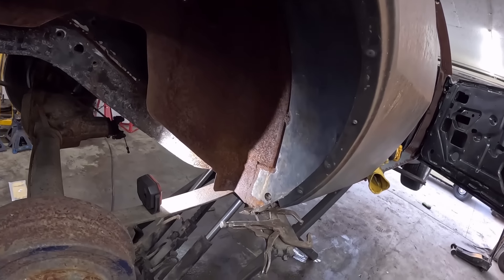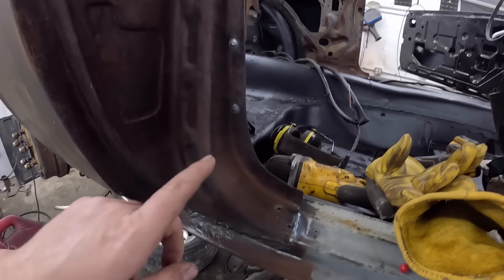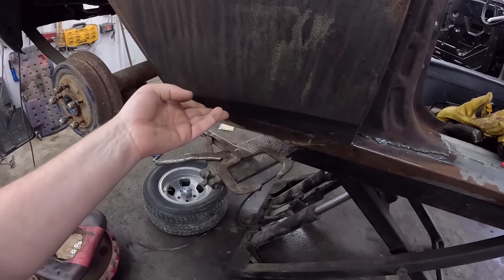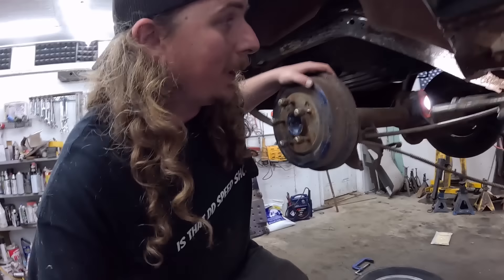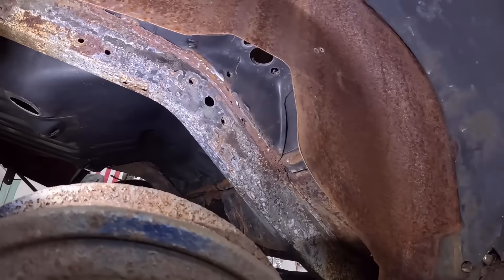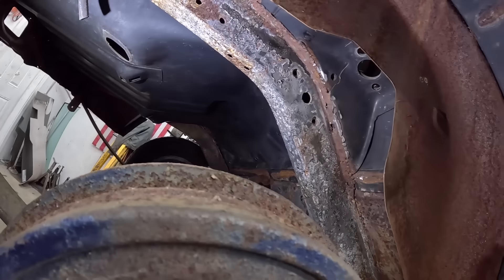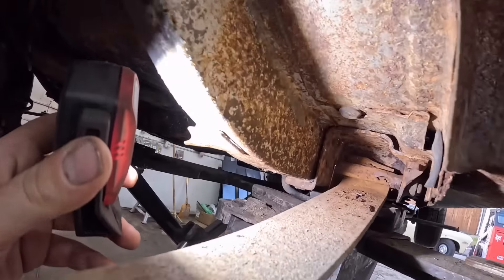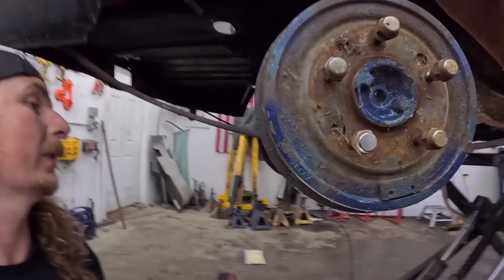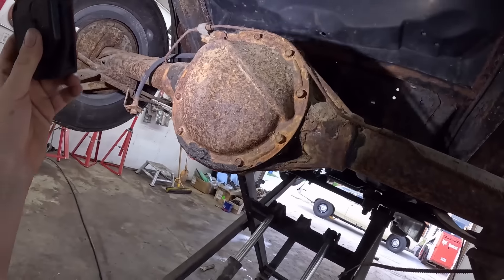So the inside's all kind of plug welded together. Came out pretty good. Same thing along here, buzz that all in — plugged it along there so it's pretty solid. I don't know if I want to repair this bit or not, or just kind of leave it. The old can of worms effect starting to happen, but nothing too serious. So I cleaned up in there, just ready for some seam sealer and whatnot. The guys didn't clean up any of these welds. While I was under here though, I noticed the front spring is in fact hanging on for dear life. So that's that. I assume whoever's buying this thing, you want to change maybe the leaf spring anyway — well, now I know you are. But it'll move under its own power. Maybe.